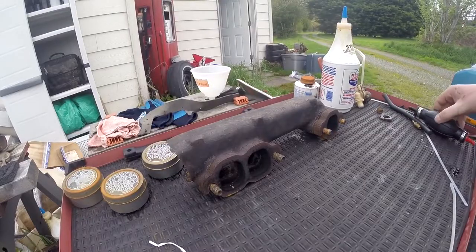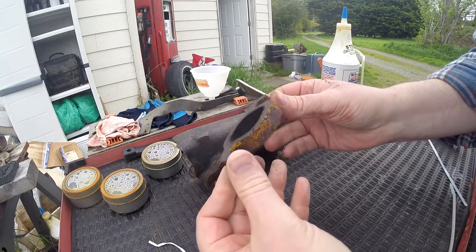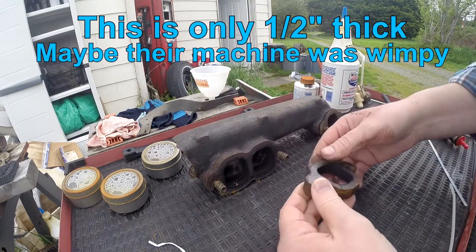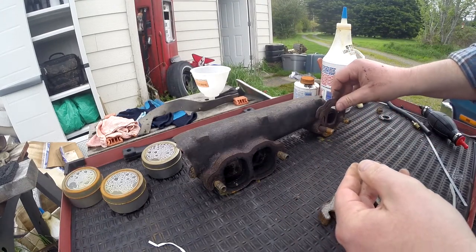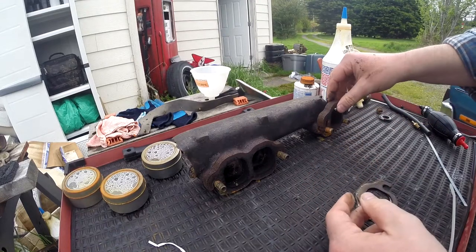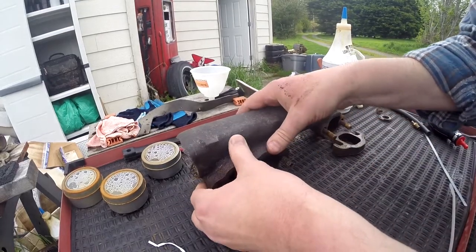Here's the manifold — just a standard Chevy cast iron. Here are the spacers dad had made; these are water-cut. One thing I admire about the Chevy design is that you can just drop the gaskets right in there with the bolts in — you just back it off enough to get the gaskets down in there. You could actually replace the gaskets without taking the entire thing off the car, and if you back off the bolts enough you could even get that spacer in there.